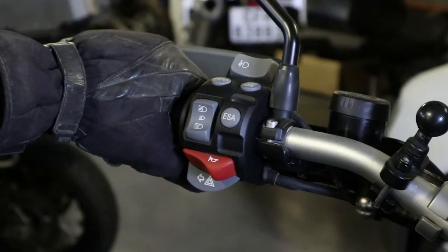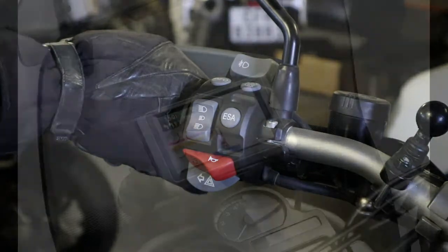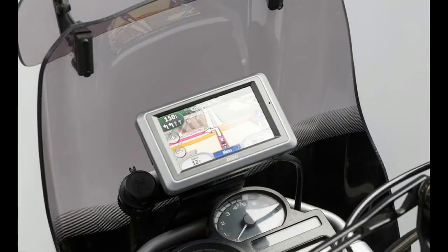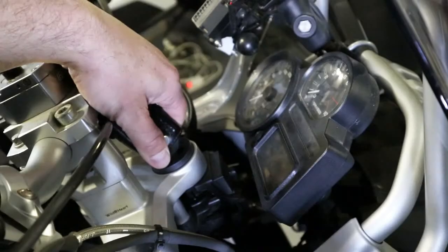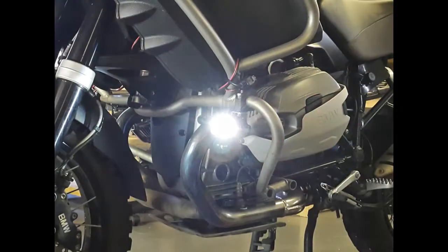When you install accessories according to any of the 3 configuration options, note these important points. When a power output channel is assigned to the horn, the accessory can only be activated by pressing the horn button. When a power output channel is assigned to a switched accessory, the accessory will receive power when the ignition is switched on. Power to the accessory will be cut after the set timeout limit.